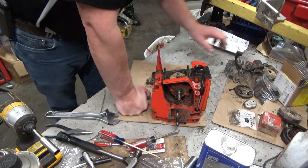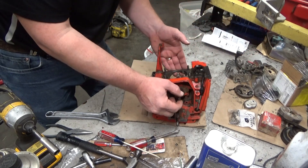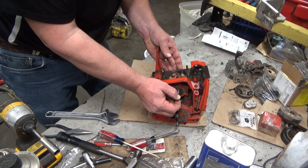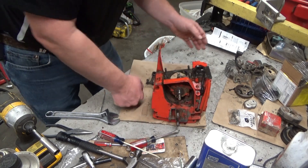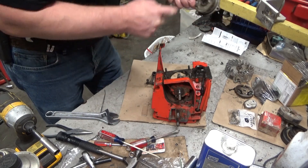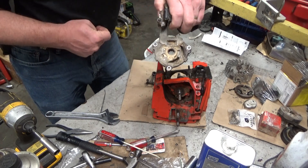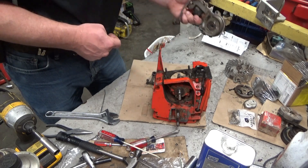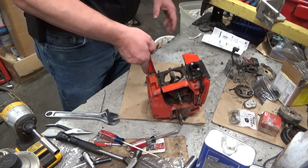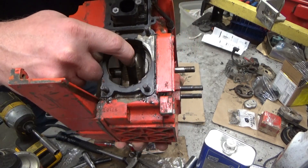So anyway, with the clutch still loaded together, I thought there was a little too much movement up and down here. I went ahead and got the ignition pulled off. This bearing on the flywheel side didn't seem terrible. You can see there's some concrete dust built up in there, and that's not abnormal. But once I got all this apart, you can see that same dull look on the crankshaft journal right here.